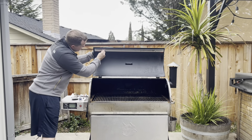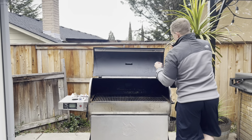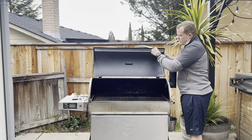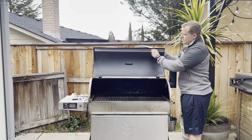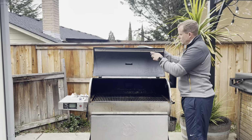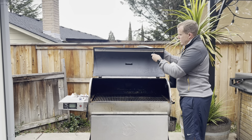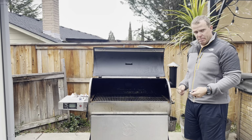We can start our second bolts in each. And then again, we are using an Allen button head stainless bolt here because previously we lost one of ours. So you'll notice when I go to tighten these up, I'm going to be using that T-handled Allen wrench. So you just want to go ahead, give these a nice snug. Once you tighten those down, again, we want to let this RTV cure for a minimum of 12 hours. 24 hours would be best.